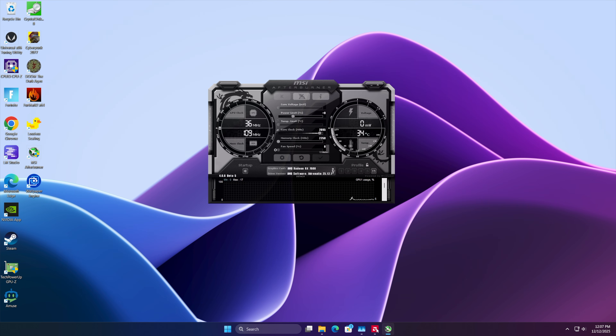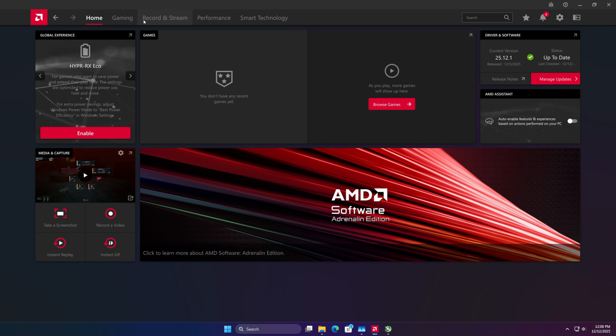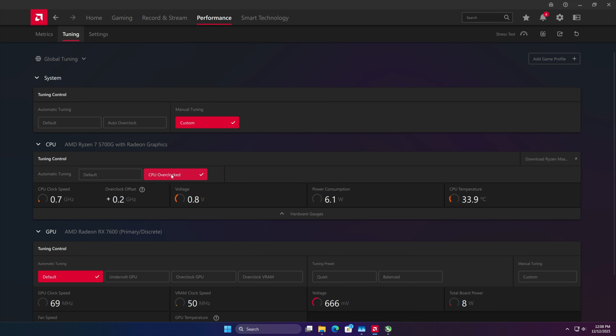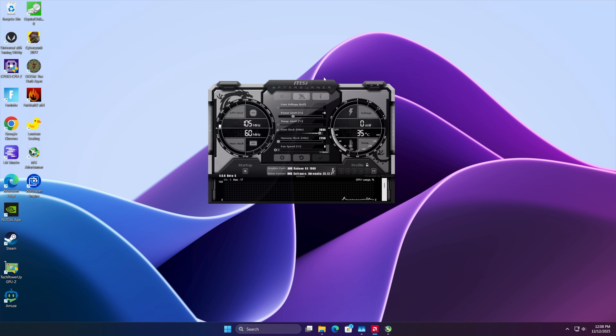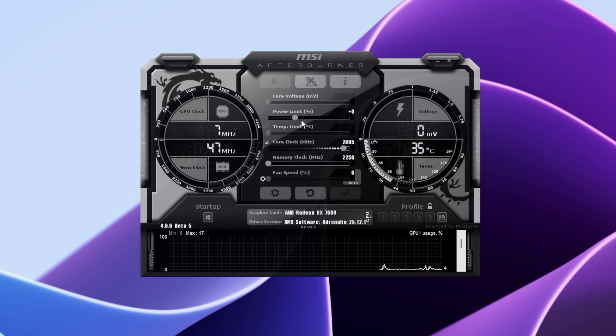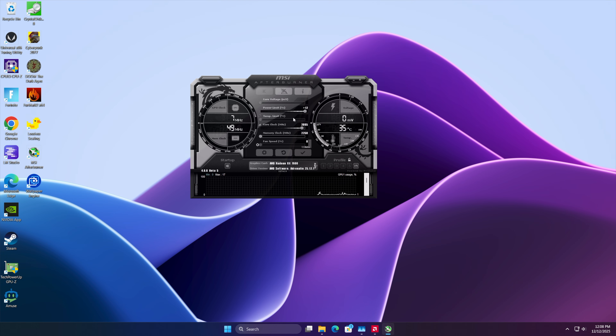There were a few things I did here. First, it's an HP pre-built so not a lot of overclocking can go on, but under Performance > Tuning, I ran the CPU auto-overclock, which brought us up by 200 MHz. It hasn't caused any stability issues so I'm leaving it there. I was surprised I could do this on a pre-built HP. We can also adjust the GPU — instead of overclocking the core, I like to up the power limit. With MSI Afterburner, the power limit defaults to 100%, but with this XFX card we can go up to 112%, throwing a little more wattage at it to reach higher clocks. I'll just apply that.